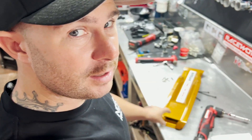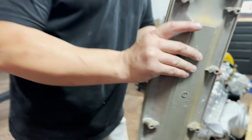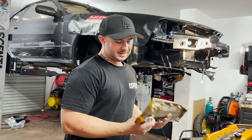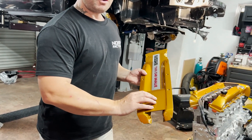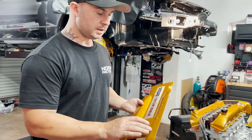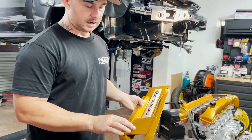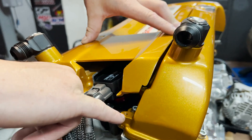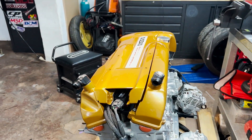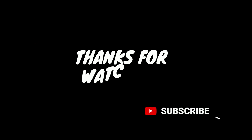I'll be very careful and dubious about how this cutting is going to go. I have fixed it - I very carefully cut out the back bit that hits on the rear coil pack. It's a little daunting because the piece I had to take out is quite structural. We had to weld it up, and welding this 90s cast alloy is terrible stuff - it is possible but you need to take your time and go slow. I had already removed the rear bolt holes which I think are useless and get in the way of wiring. I'm pretty happy with that - we can still use the valley cover. It's pretty cool.